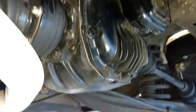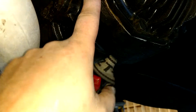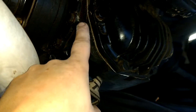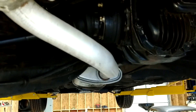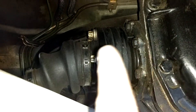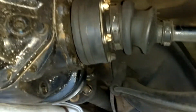Perfectly dry around the rear end. It looks like someone resealed it — there was no seal from the factory — so they must have changed the fluid in there. My other 1980 300SD has the can-style axles; this one has what looks like the service replacement style. I don't know if they were doing this later in 1980, so some cars had it and some didn't.